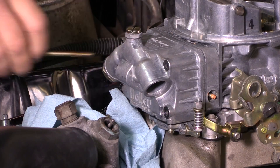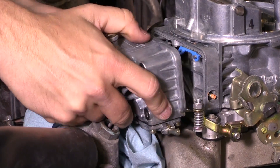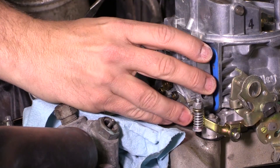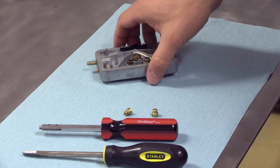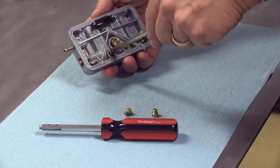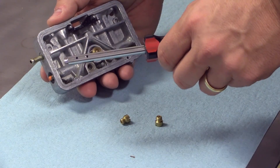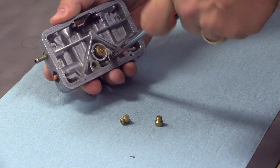Next, finish removing the other three bolts and pop the fuel bowl off. Looks like it's finally time to replace that gasket. Then remove the metering block - you may have to use a flat-bladed screwdriver to get a little leverage, just be gentle. Depending on your carburetor, you may also have another metering block on the back of the carb. There are two jets in each metering block just below the power valve. The jets are slotted, so you can use a screwdriver with a wide blade to simply unscrew them. But if you're regularly working with carburetors, it's definitely worth investing the 15 bucks for a jet tool, which centers in the jet so it can't get damaged.